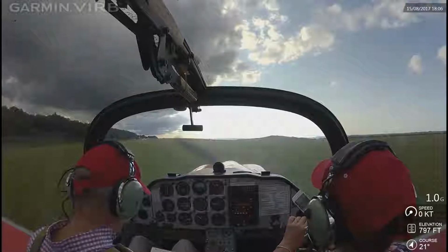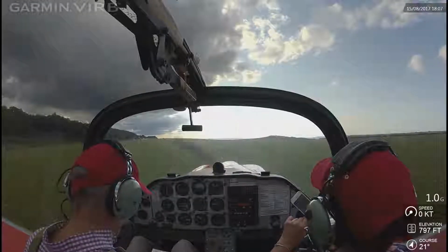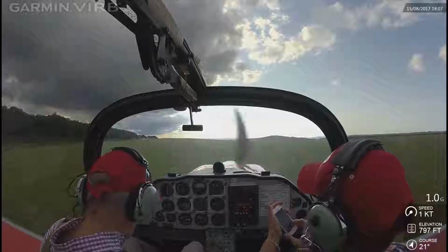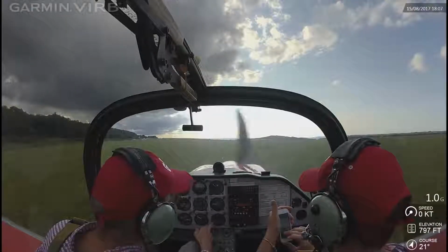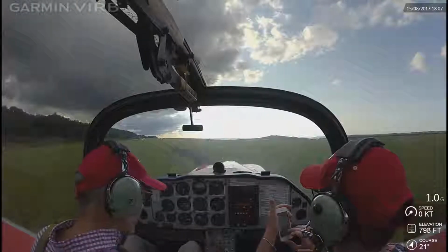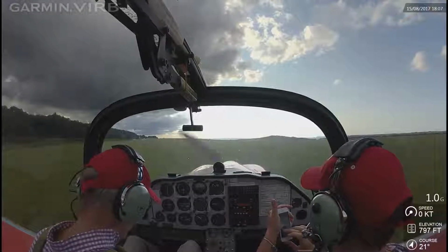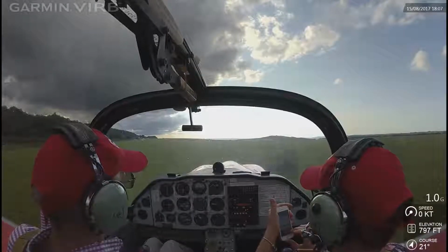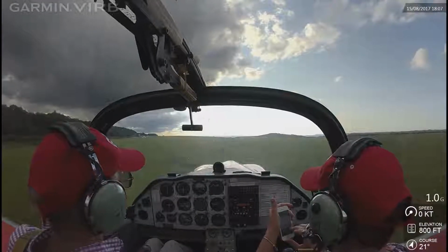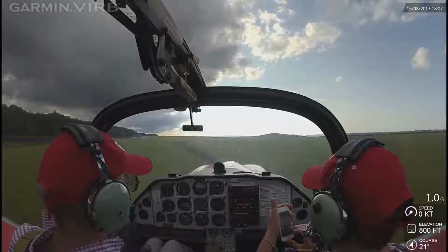Pre-taxi, done all that. Brakes, instruments, rudder left and right. Run up, parking brake is on. Fuel set to both. Oil temperatures and pressures are good. Mixture goes to fully rich. Throttle, we'll pull this back. We'll push this up to 1800. Exercise the propeller.